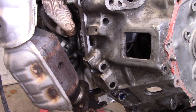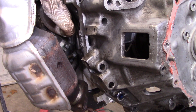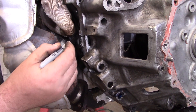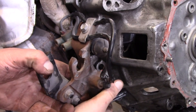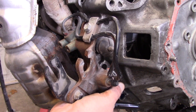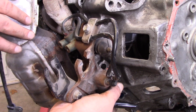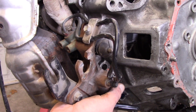That brings us to the other side of the motor. We can see the motor mount wants to go here, so this ear here on the motor needs to be lopped off. There's a threaded hole there but it doesn't get used in our application, so don't worry about it. Up here you can see where the slave cylinder mounts — it gets awfully tight in this area. Something else I want to talk about: the reason I left this stock manifold — you can see it just barely clears the clutch, but then there's going to be cables coming in here that are going to hit right on the catalytic converter. If you need the catalytic converter on this motor, you're going to need to fabricate something here. There's a whole pile of different exhaust manifolds available and the pattern is the same on both sides, so you can try different ones, see if you can find something that fits better. As far as the clutch goes, you could do away with just a heat shield, but that's not your only problem here.